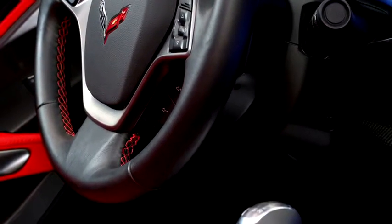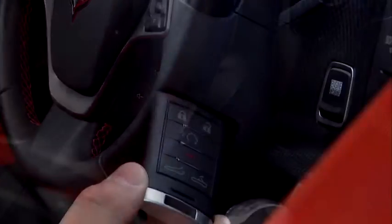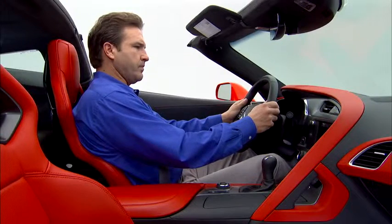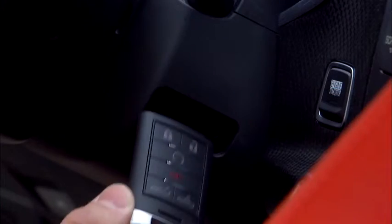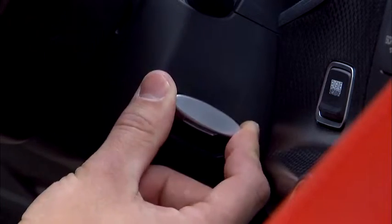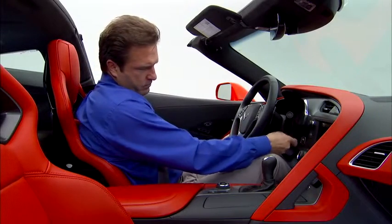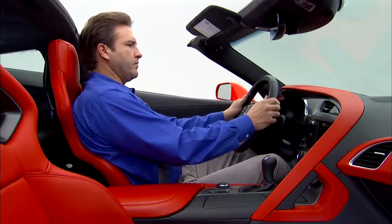This pocket is located in the steering column on the right side. Insert the transmitter into the pocket. The position of the transmitter is important — it should go into the pocket with the buttons facing up and the base towards the opening. Press the transmitter into the pocket until it seats.